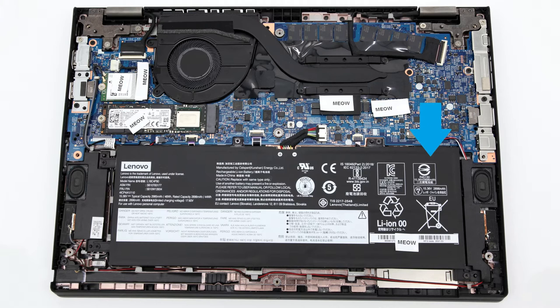As you can see, the battery is there. It's quite large, and RAM is soldered on board, so can't be changed. M2 takes single-sided sticks. It's going to let you upgrade quite considerably. Wouldn't suggest double-sided SSD because that would potentially bend your motherboard.